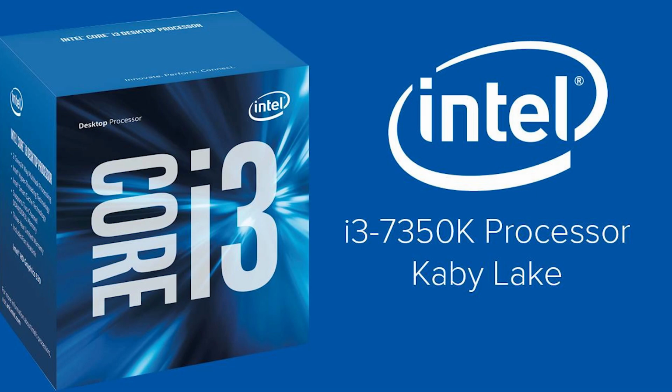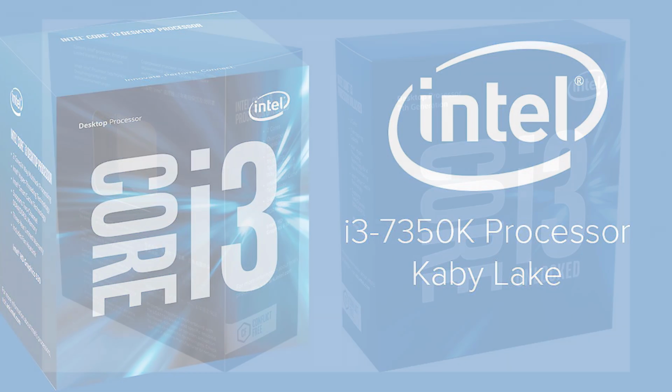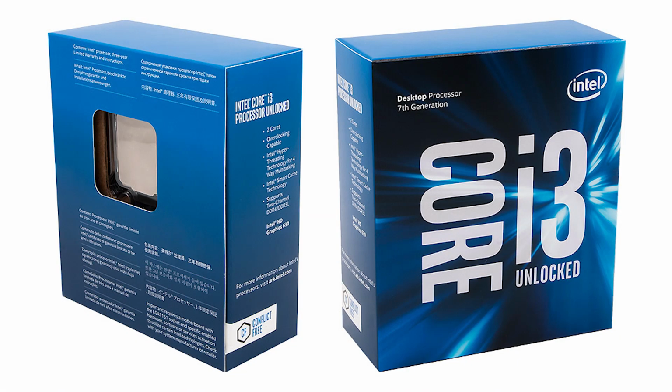So first up we have the i3 7350K, which is clocked up to 4.2 GHz. Now because this is hyper-threaded, it has 2 cores and 4 threads, basically making it equivalent to a low-end i5. The reason why I chose the 7350K i3 variant over an i5 is because of its heat. This CPU only has a 60 watt TDP, whereas a lower tier i5 has a 65 watt TDP. Now this might only be 5 watts more, but I do suspect that the lower i5s will produce more heat.